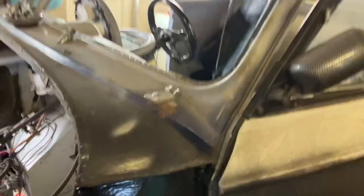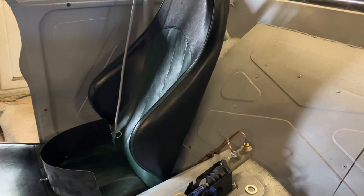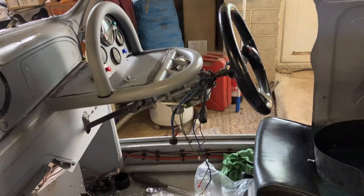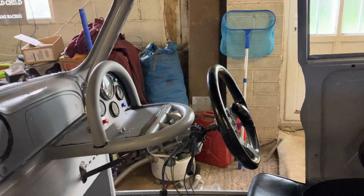As you can see on that side, all the wiring runs neatly along the sill, and on this side of the car is the fuel line that snakes through the front firewall. A lot of the brakes are plumbed — the system to the rear is plumbed, so just after the hydraulic handbrake it goes back through the firewall, waiting for a flexi-hose to link it over to the back axle. We're running a Land Rover indicator stalk which has high beam and horn on it as well — saves a couple of extra switches and buttons. I have flipped it over, just because it's a lot easier and more convenient on that side.